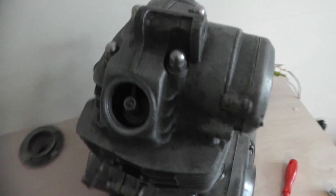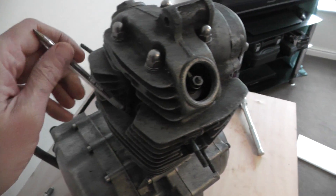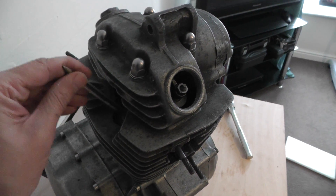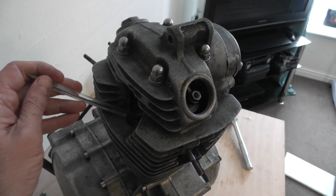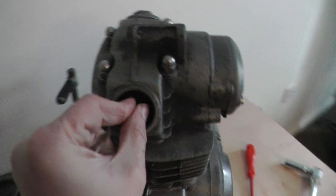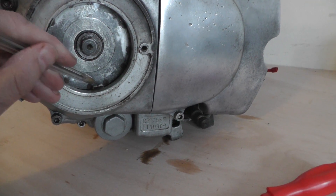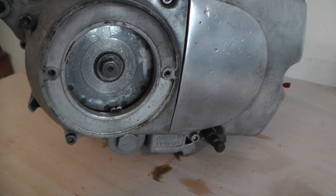Also, I use a big pen so it won't get crushed to make sure the piston's at the top of its travel. So that's it — piston's at the top, your valves are not being operated so you've got a bit of movement there, and your timing marks should line up. It's that mark there and that mark there, so that is it.